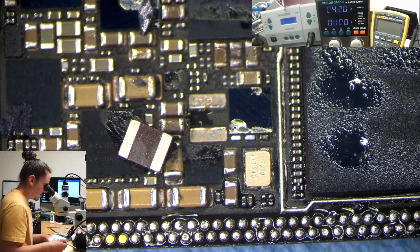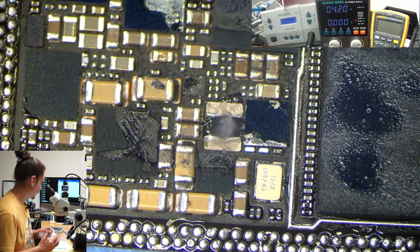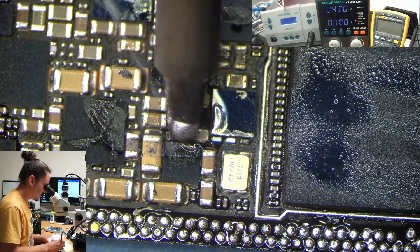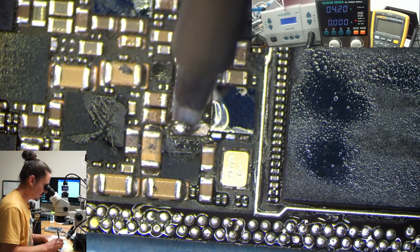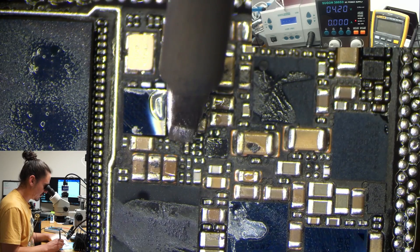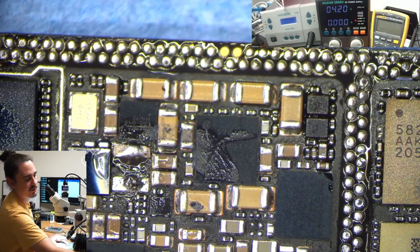This is one of the more common problems I see on this model, so I need to check here just from experience — I've seen this problem many times. In general, a small spike or even no amp draw before or after a prompt to boot usually means either a bad power rail. Checking NAND first is always the most convenient because NAND is usually right on top, and on the 12 Pro series and 12 Pro Max, the boost coil is always the next thing I check. The boost coil is for the boost circuit that boosts the voltage when it goes low, and the phone doesn't work without that circuit present.